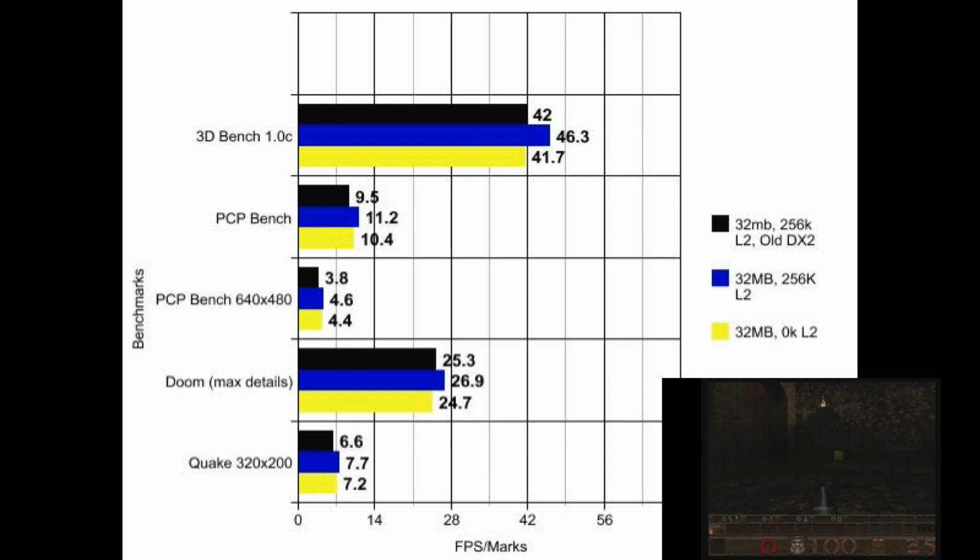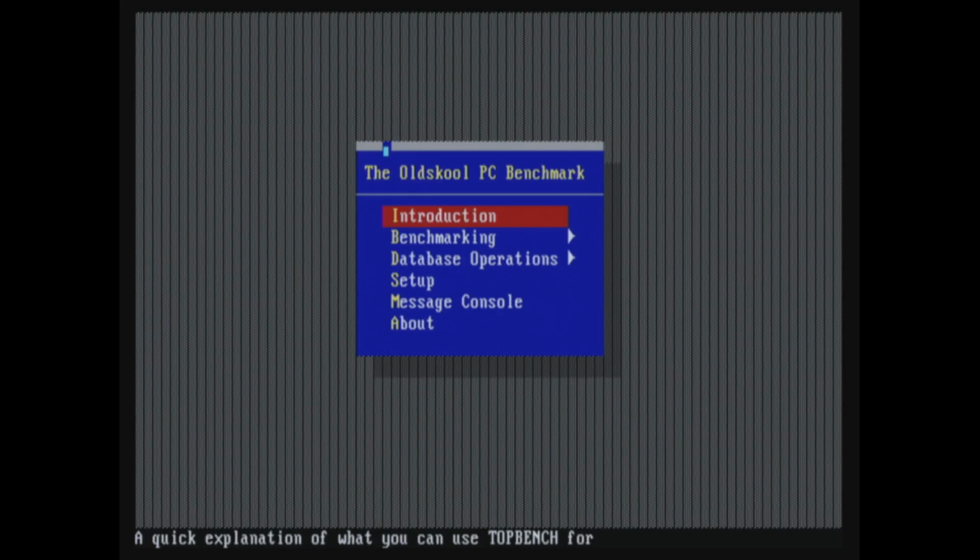This took a little bit of thought, but usually I like to just hook up traditional spinning disk hard drives. I'm going to do something a little bit different with this build, and I am using a 1 gigabyte compact flash card. I hear these Western Digital Silicon Drive ones are pretty reliable, and they're pretty good for acting as hard drives. I'm just going to be installing DOS 6.22, nothing else, so it should hold up.